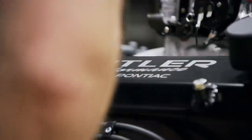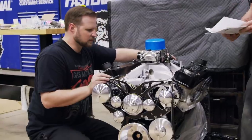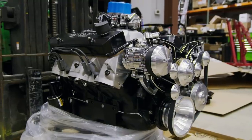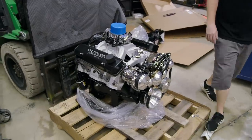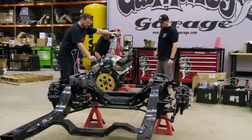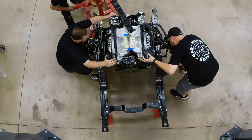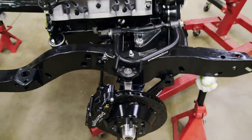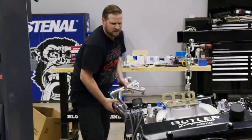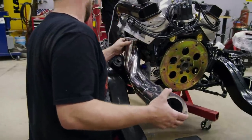You know how valuable it is when they wrap it like this. Dino's at 550 horse. We'll pull the carb off, put an engine hoist on it, and drop it in. Since the 467 motor came ready to install, we can fit it straight into the subframe and be ready for the headers and transmission. The subframe and everything attached to it will be one giant time-saving pre-built unit. We're going to test fit these headers right now — if they're all clear, we'll get the transmission out and bolt it in. The trick with these headers is squeezing them in with a massive motor — when you up the horsepower, you usually lose a bunch of room in the engine bay. More power and more engine — they need to fit because there's no plan B.